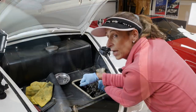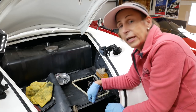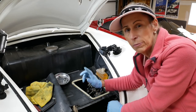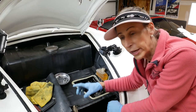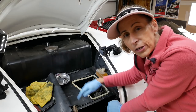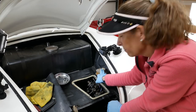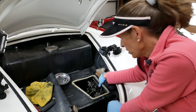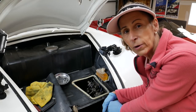Everything else looks really good. This reservoir over here is for the brake fluid. It's actually not from a '55 — the original 1955 would have had a single circuit brake system, which is a single point of failure and actually kind of dangerous. The reservoir sat on top of the master cylinder, buried down there — you almost had to get under the car to check it. A lot of people have replaced the master cylinder with a Volkswagen Beetle dual circuit master cylinder, and when you do that it comes with this sort of external tank for the brake fluid. Anytime you see that in one of these cars, that upgrade has been done.